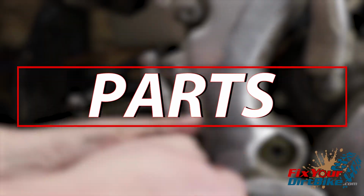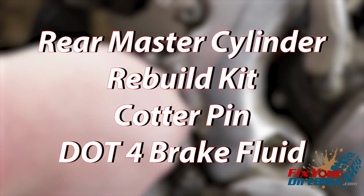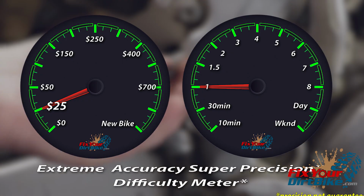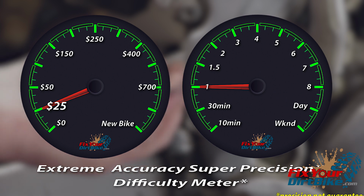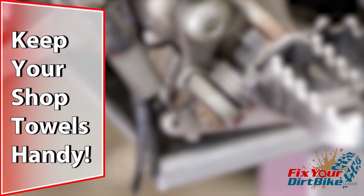glasses. The parts you will need are a rear master cylinder rebuild kit, a new cotter pin for the brake lever, and a fresh bottle of DOT 4 brake fluid. You can get all the parts you need through the link below. This rebuild should cost no more than $25 and take less than an hour to complete. Brake fluid will damage almost everything, so keep your shop towels handy.